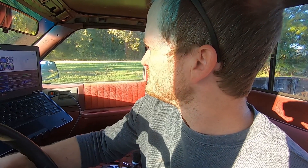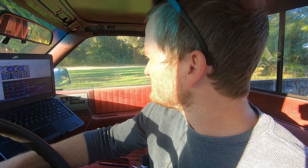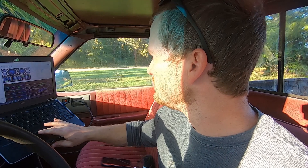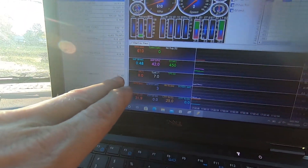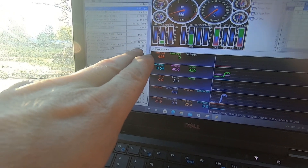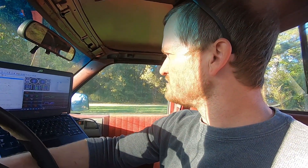My knock retard didn't do anything while it was running. Let's crank it up one more time and look at that. There's no knock retard going on, and timing advances at 8. I'm up to 162 degrees. No check engine lights have popped up, so I really think it's either the coils or it's running low on fuel. It sounded good now that it's warmed up.